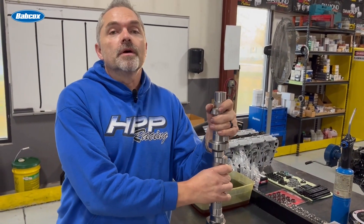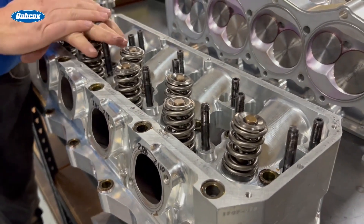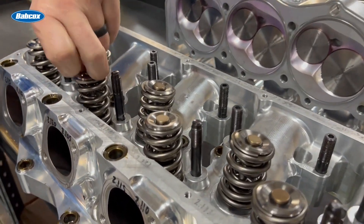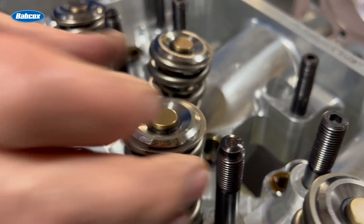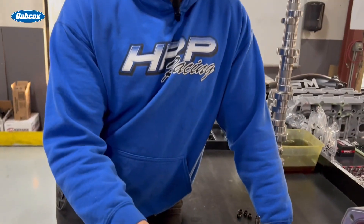So we reground the camshaft to our lobe profile and put our valve train package in it. You can see we go with a significantly lighter spring — only about 380 pounds on the seat and 975 to 1000 pounds open. We use a Victory titanium retainer and keeper combo, which has a trash-can style keeper, so it gives more surface area — just makes a much better piece. This is proven stuff: drag week proven, drag-and-drive, big horsepower — like in Bailey's car, my car, Manny's stuff, Eric Bain's stuff. Tried and true, and we've converted this whole motor over.